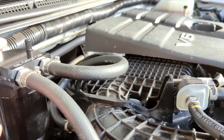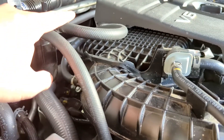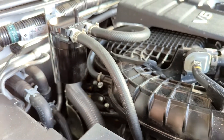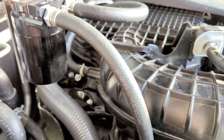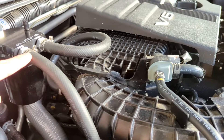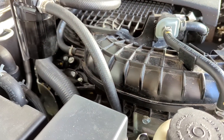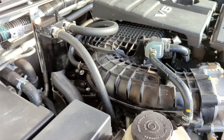No modifications to the catch can itself. The kit came with about two feet of fuel line and I just used that, cut it for what I needed, to go from the intake into the catch can and back into the intake manifold. Not too much modification needed overall.